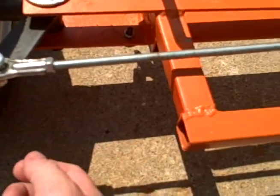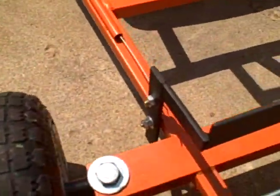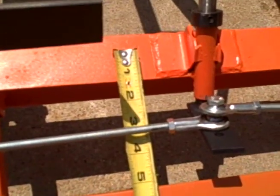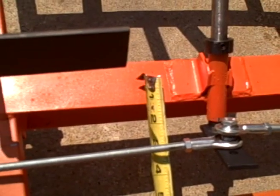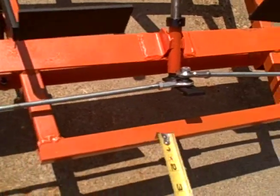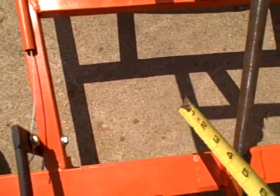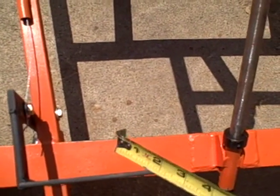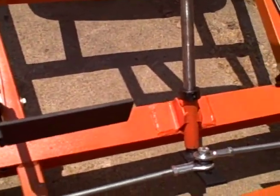These arms were just $12 ones I bought from Northern Tool. You can see how the front of the frame was constructed. From the center of the main support arms going out to the front of the bumper is about 6 inches. My pedals come up in front, so right now we don't have a floor on it, but it's easy to just rest your foot right here and push on it. Since your legs are up, you're pushing this way, so your feet never fall through. At some point I might put some metal in — a little metal floor — but I just haven't got to that point.